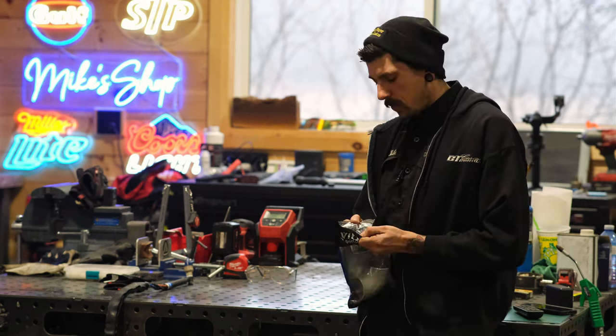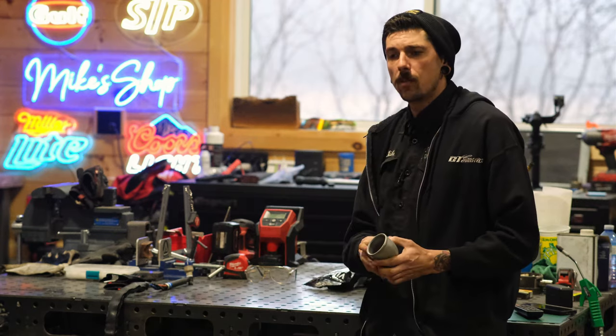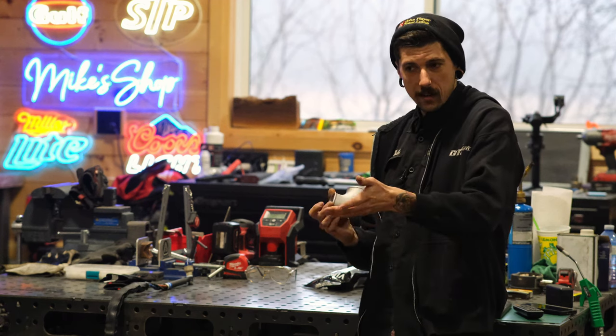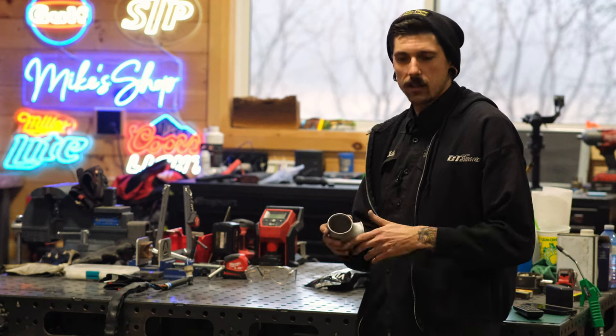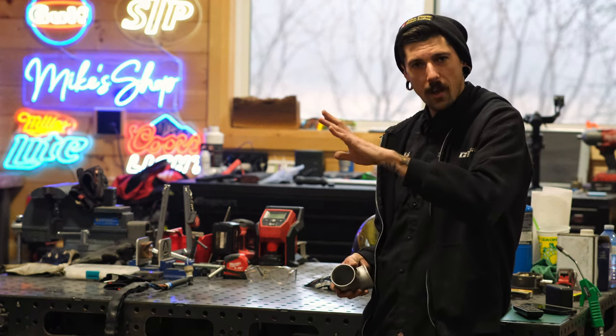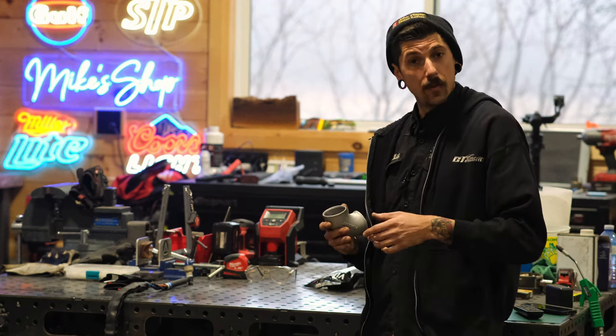We're gonna bring it on over to the Mustang, the 1J, and clock the new PSR turbo, line up this elbow and have it pointing where the intercooler is, because it's a mid-mounted intercooler, similar to what I'm making on the 240 at the shop. This is just already there. So again, the cold side is done, it's on there. We're not changing that. We're just getting this setup going with the new turbo on it.